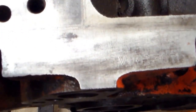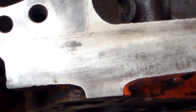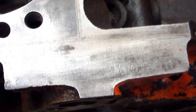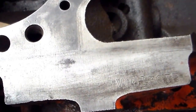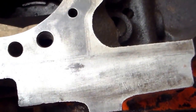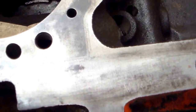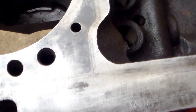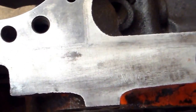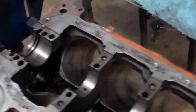CTB is the LT1 code for the Z28 motor, not the Corvette engine — the Corvette engine had a different number. Also notice there's no VIN on this side. If this motor had been installed at the assembly plant for a car, there would have been a code like an A and then a VIN number. The fact that it has no VIN tells me it was purchased over the counter. Our friend's husband was big into cars and drag racing, and she said he had purchased this engine for racing — it never made it into production for an automobile. It could have gone into a Z28, a Nova, or I believe also a Chevelle.